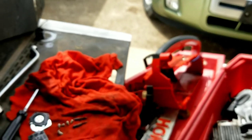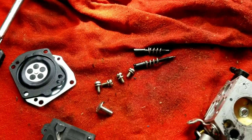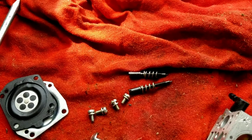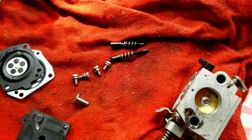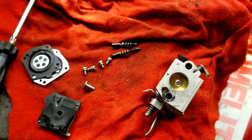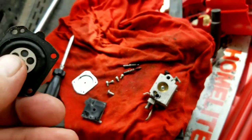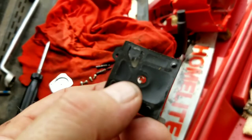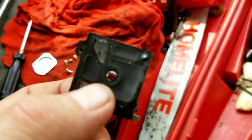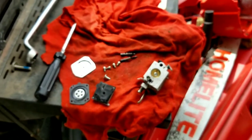What we're going to do is get the carb cleaner, blow out all the holes and all the little nooks and crannies, then reassemble it and adjust it. When I remove the adjustment screws, I always place the high speed screw on top and the low speed screw on the bottom — high and low — so I don't get confused about which is which, because on a lot of carburetors you can screw them into the wrong hole very easily. On this one, the spacer goes closest to the body on the carb and the pump goes above it, but on the other side the diaphragm goes on to the carburetor and the spacer above it. Just take it back apart and put it back together the same way you took it apart and you'll be fine.